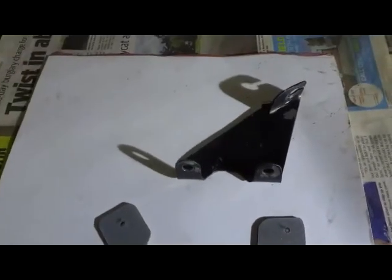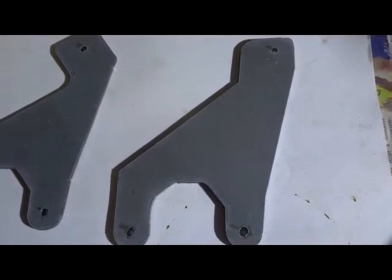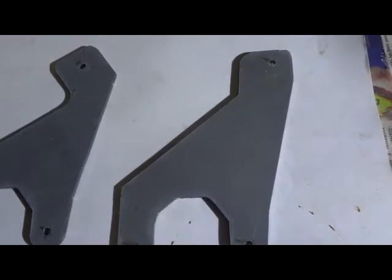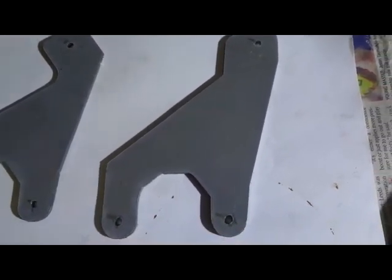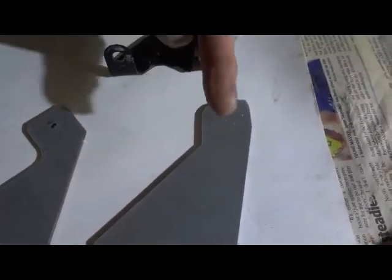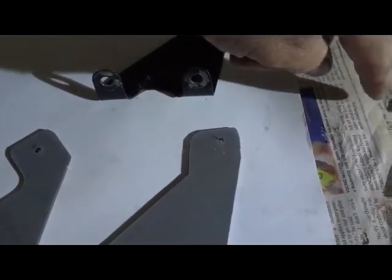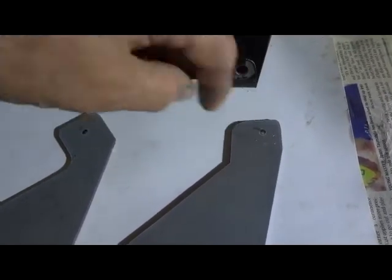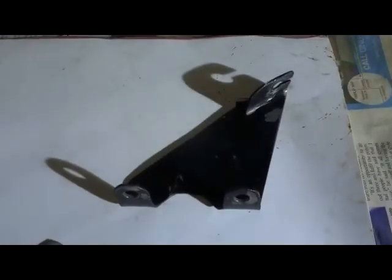Okay, that is a template of the original cable attachment which goes onto the supercharger, so you can run the pressure cable down to the automatic transmission. The biggest issue with that, when that bends up straight, is the cable comes in straight from that direction, but unfortunately it's so close to the back of the firewall that it has to come around a really tight corner, which causes it to jam. So I'm trying to fix that this time. This is my first attempt.